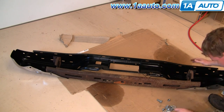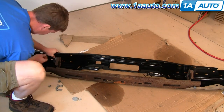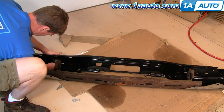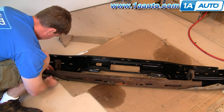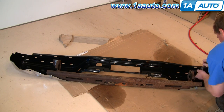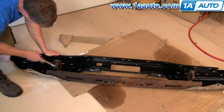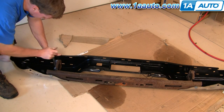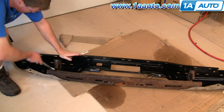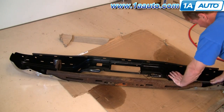Fast forward as I do the other five — there are six bolts total. What I do first is just put the carriage bolts through, then put a large flat washer, a lock washer, and a nut and hand-tighten them. Using my socket and ratchet, I'm going to snug them all first. If you snug them all first without tightening all the way, it gets everything set right. Then once you have all six kind of snug, go around and tighten them all up nice and tight. There's no real need for any torque specification on these.